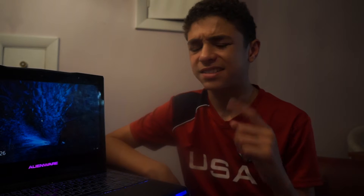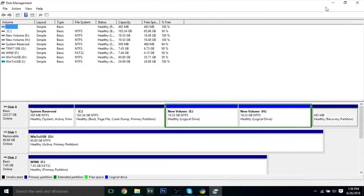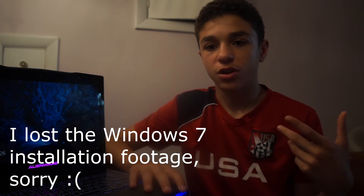I'm not going to waste any more time. The first thing I did was connect a flash drive. After that, I partitioned my hard drive so that I could make storage for the Windows 7 installation. Then I booted from a bootable flash drive I had made using Rufus. Afterwards, I officially began to boot up the Windows 7 installer. After completing the installation, which took a very long time, I eventually had Windows 7 running on my system. It was actually a Tiny 7 ISO, so that it would fit in a small footprint and keep the installation file small.